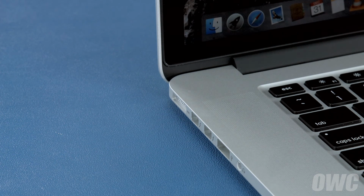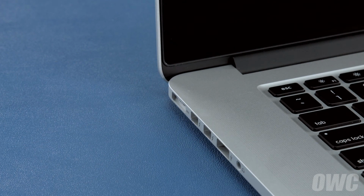You can still use it at this time, but don't do anything particularly heavy. Steady and even usage will result in better power system calibration. Once the battery is discharged, your computer will automatically shut down. Leave it shut down for at least 5 hours to ensure the battery is completely drained.